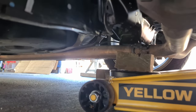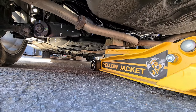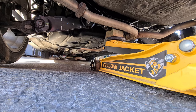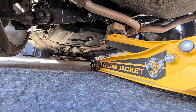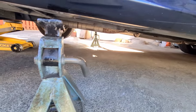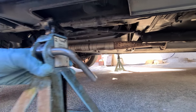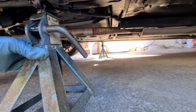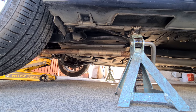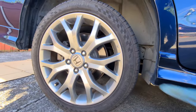The factory jack point is just up there. We'll go ahead and put the jack stand underneath — the location is just there. Make sure you center that. I usually like to leave the jack in place while the jack stands are there as well, for additional safety. Now we can go ahead and take the wheels off.